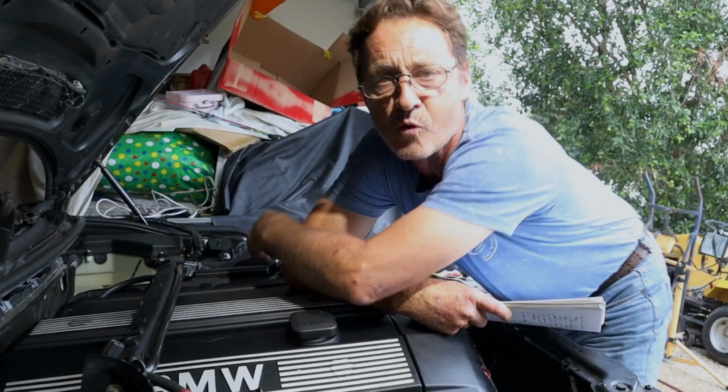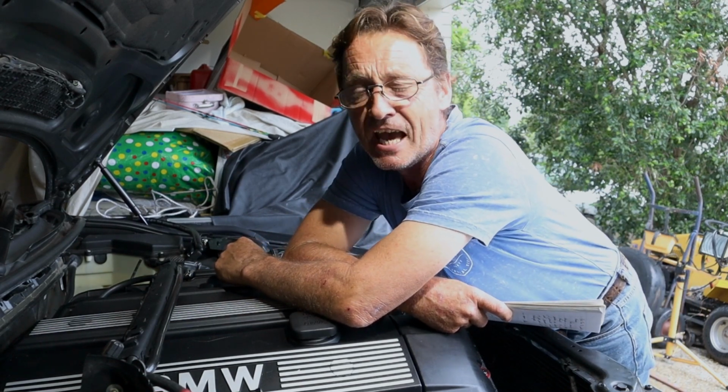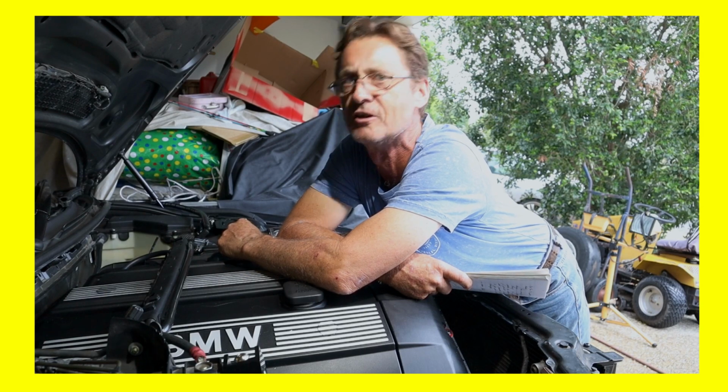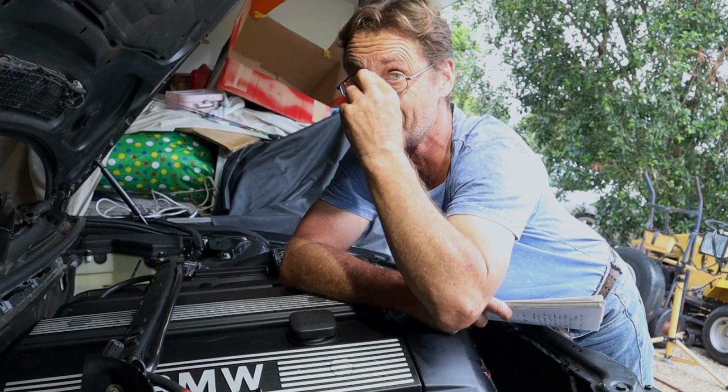The bracket itself for the supercharger I found really challenging. It's quite fiddly and it's a matter of replacing a couple of the bolts out of the alternator. What I found tricky about that was having to line up the bolt hole through the bracket, through a spacer piece, and then through two slots in the alternator. Getting all those to line up millimetre perfect was a real challenge. Just take your time with it, don't get too frustrated, and it will eventually all go together.